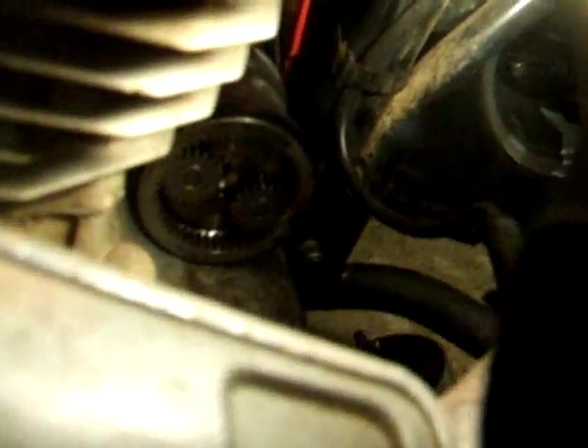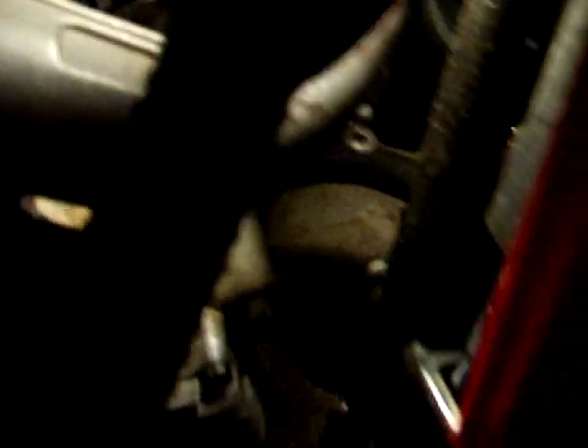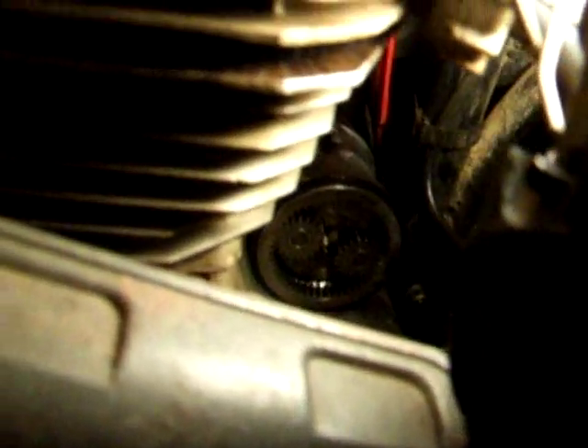So I just put the motor in, and put the two screw bolts on. If you use these two screw bolts, you need a screwdriver like this — sort of a rounded head Phillips screwdriver. You can just barely get one of the screws in because of the exhaust pipe. But if you push very hard on it and don't wreck the head, it'll work fine. I can get the motor in and out in ten minutes now instead of half an hour — no stupid cover and gasket and everything.